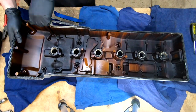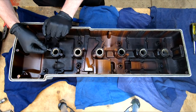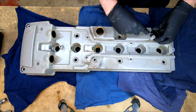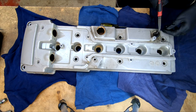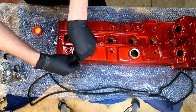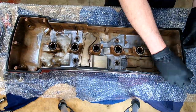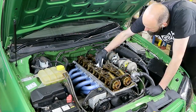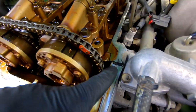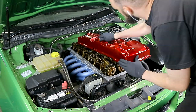We can then start to prepare all our gasket surfaces. As I'd already removed the old gaskets from the cover to paint, we'll demonstrate on this one that's just come off. Carefully pry them out, trying to avoid leveraging against any of the surfaces that seal. A trim removal tool may help as it won't scratch or mark the cover, but it can be managed with a small flat head screwdriver and some care. This kit also comes with a new PCV gasket, so we'll remove that as well — make sure you pull it out rather than pushing through, or it could be fun to get out from behind the baffle plates. You can then push in your new PCV seal using a small amount of engine oil to help as it's a really tight fit. Flip it over and start putting your new gaskets on the underside of the cover, making sure the surface is clean. Back to the engine: carefully clean off any gasket surfaces around the head with some brake or throttle body cleaner, making sure not to push any material down into the head. It's recommended to put some gasket maker at the two points where the head and timing cover meet — I'm using some Permatex Ultra Black for this. The cover can then carefully be maneuvered into place.